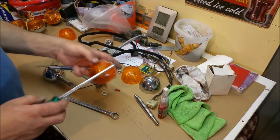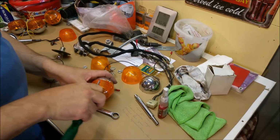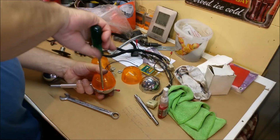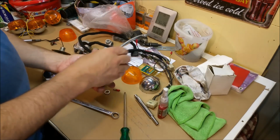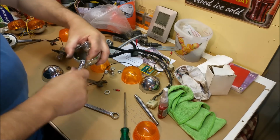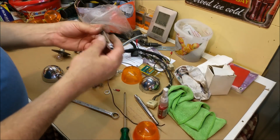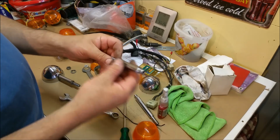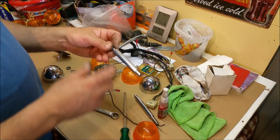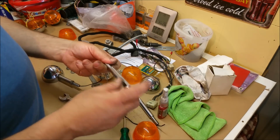So here are lovely steel cased ones, and we'll use these with the different length post on them. The OE ones are the best, obviously. These are steel casing, right? And we can just take these piers off. They're dead easy to make. I can make them out of bright steel. These are chrome plated, but you can get bright steel. You can turn it really fine, run some 1000 grit if you like, up and down it wet while it's on the lathe. Buff them out and then just clear them, whatever.